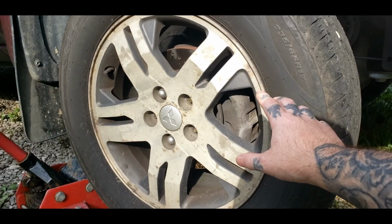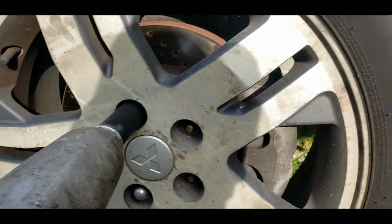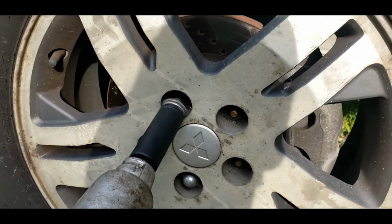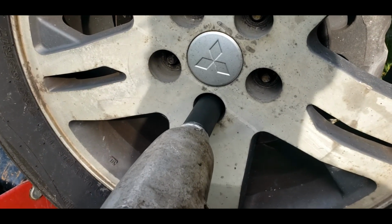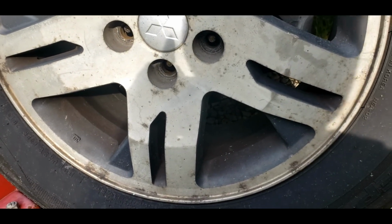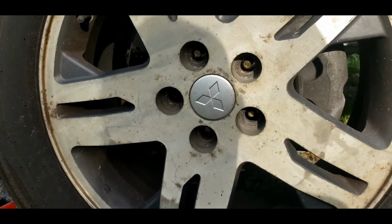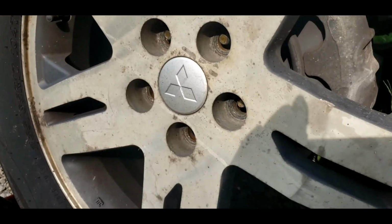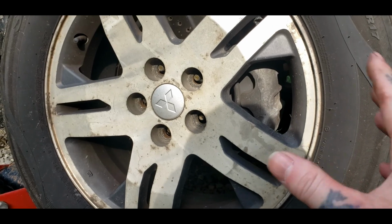So now we got this up off the ground. We are going to take a 21 millimeter socket, put it on an impact, and loosen them. If my impact sounds a little bit weak, it probably is. It's got 200 foot of hose on it at the moment, stretched way out here where we are doing this Endeavor, because a rollback is parked in the way at the moment to the building. So now we got this all took off.